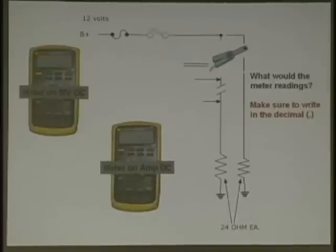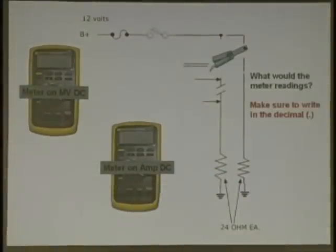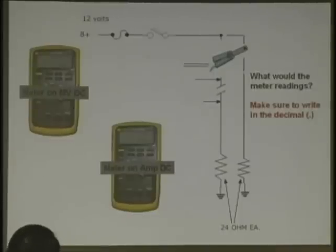Okay. Gentlemen, listen up. We got a lot more to cover. If you're all good with amps, again, unplug the meter lead. Unplug the meter lead. Very important. Because you will screw up. It happens to everyone. I was just doing a class last night, and out of 17 people, I think 4 people had good fuses in it. Yeah. Scary. Yeah, all the time. But that's very common.